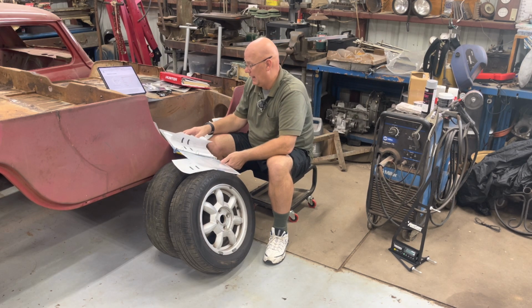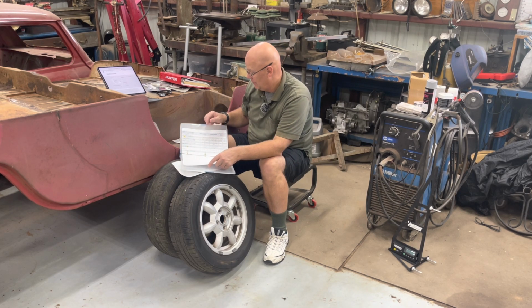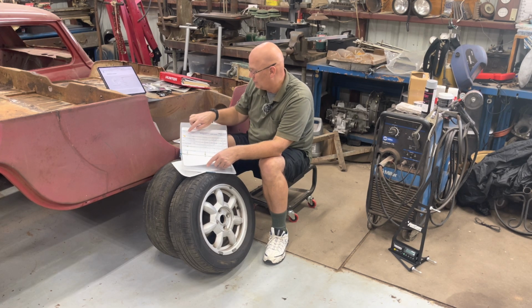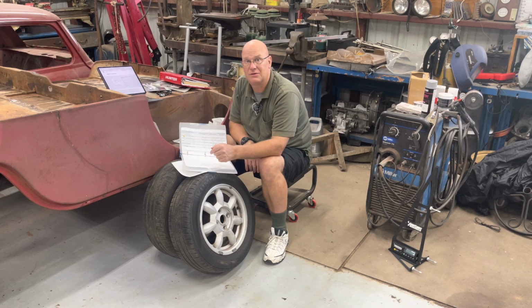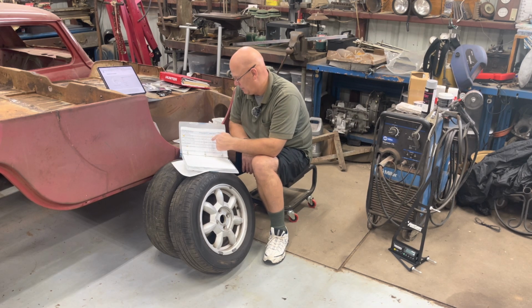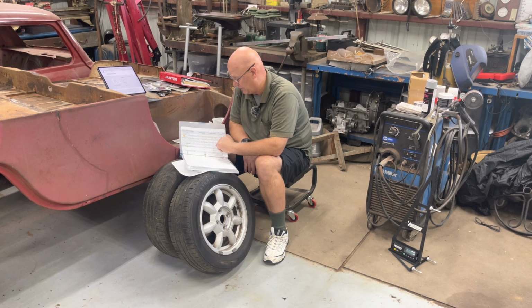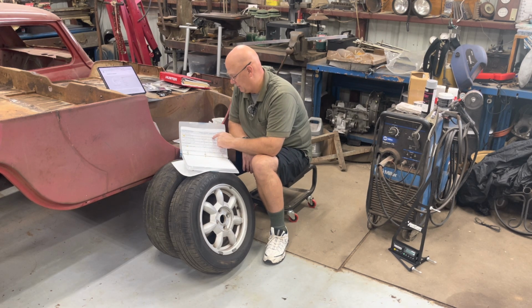Looking online, I have found what someone says is from the factory manual the dealer has. Mine has Porsche Active Suspension Management, PASM, and the total toe is plus 5 minutes of 1 degree, meaning the front tires are in a little bit, plus or minus 5 minutes of a degree. Then it says the camber is supposed to be negative 15 minutes plus or minus 15 minutes, and the caster is supposed to be 8 degrees, 30 minutes. Okay, that's the front. And the rear is plus 5 minutes, plus or minus 0.5 minutes, but that's per wheel. The 5 minutes on the front is total.